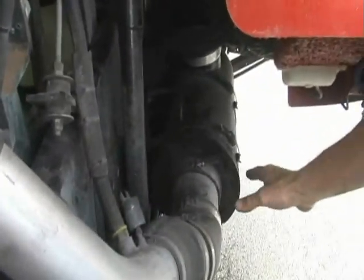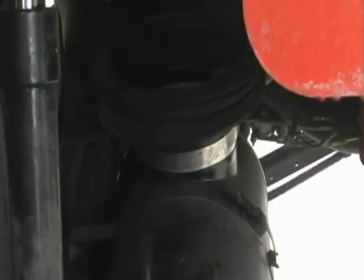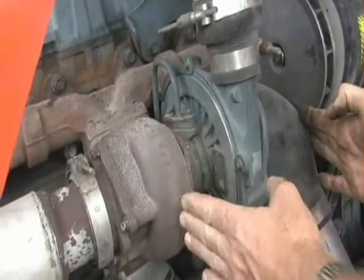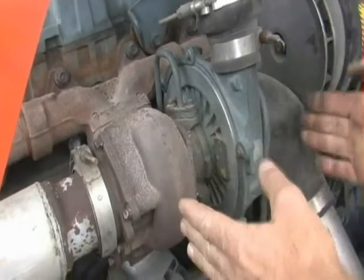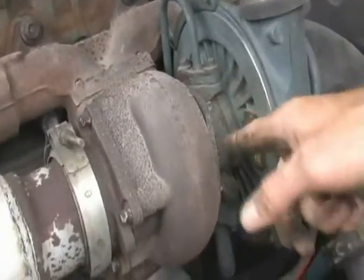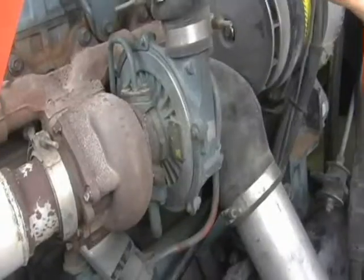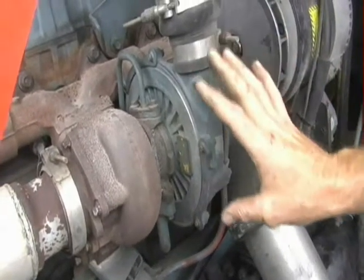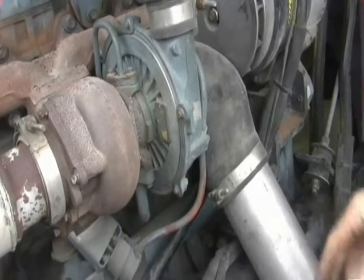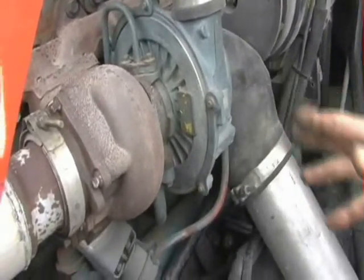Panning down, you'll see the air intake on the right side of the frame rail — this is where air comes in to the turbocharger. This is the turbocharger: we have the cold section compressor on one side and the hot section turbine on the other. The turbocharger is driven by the exhaust gases of the engine going over the turbine wheel on a common shaft. Let the truck idle for at least 5 minutes to allow the superheated oil around the turbocharger to be carried away and cooled before you shut it down — this will ensure appropriate service life for the turbocharger.